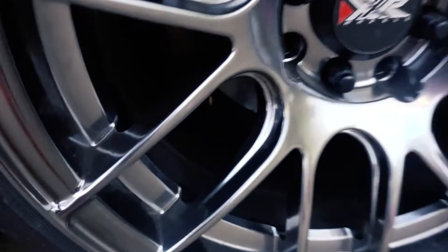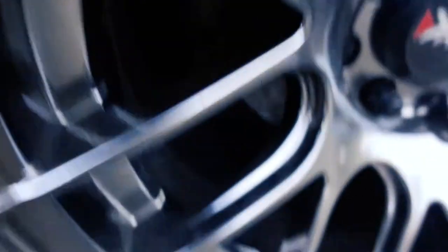I want to go pull that in reverse — and it grinds. The lower control arm bolt washer, I don't know if you can see it right there — that gold piece is actually touching the rim, which is very bad. It should not be touching the rim. That is the lower control arm bolt washer that is grinding the heck out of the rim. Not really sure how to fix it, but that's going to be for the next video. I'm going to go ahead and wrap this one up today.